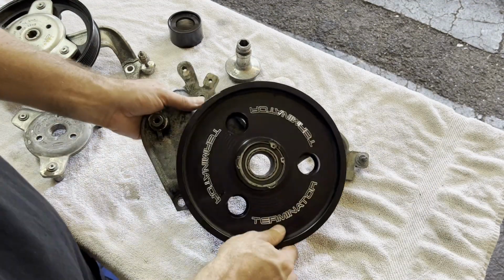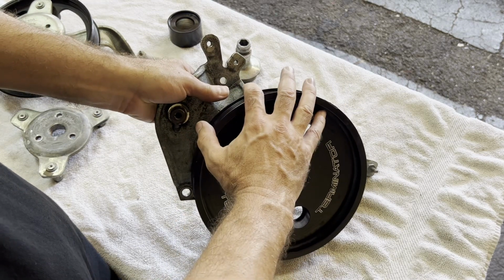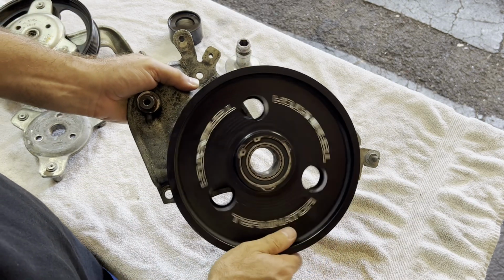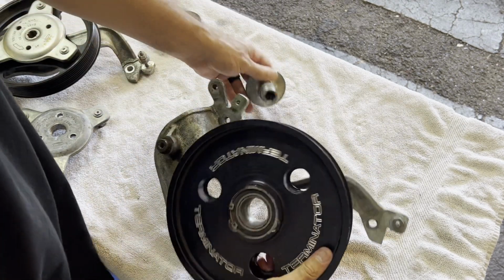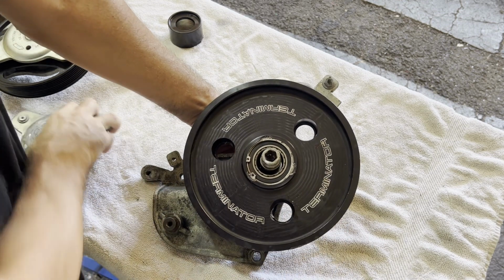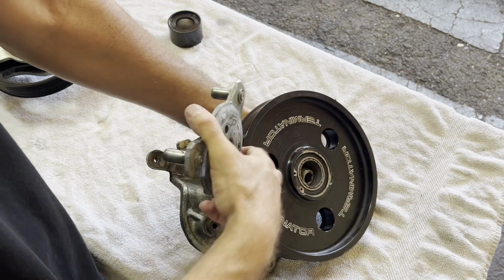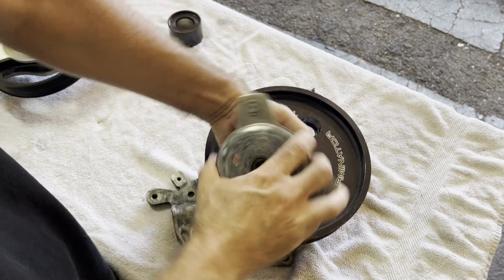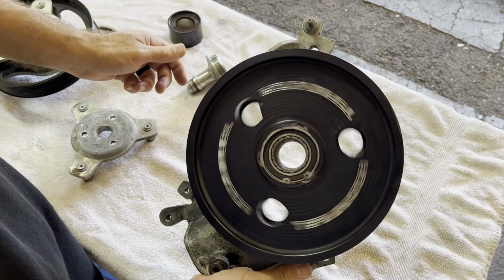If you've never seen one of these lowers taken apart and wondered how does it not have any force on the crank, the pulley is directly attached to the outer cage and has no attachment directly to the crankshaft. So the tri-bar setup, this piece here comes through the bottom and it's kind of floating. It's attached to the damper behind it, and then the tri-bar attaches on there and sits in those rubber bushings. So essentially, this is free floating from the pulley and then how it creates its turning action. And that's how this is, completely isolated from the crankshaft.